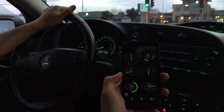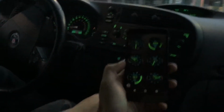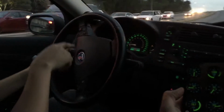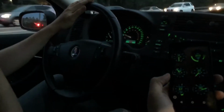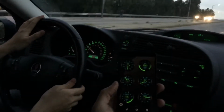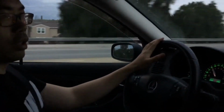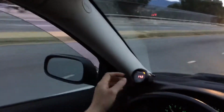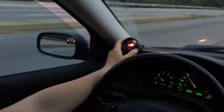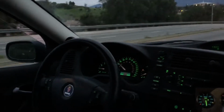And what are we doing? No check engine light so far. Not yet. Our objective of driving the car right now is that we reset the engine light, and we're hoping that it doesn't come on again and we don't have limp mode. And then number two, we're just driving around to recharge the battery. So we're really happy with our gauge install. It's there, it's running, except the fact that it's not actually connected to an oxygen sensor yet.